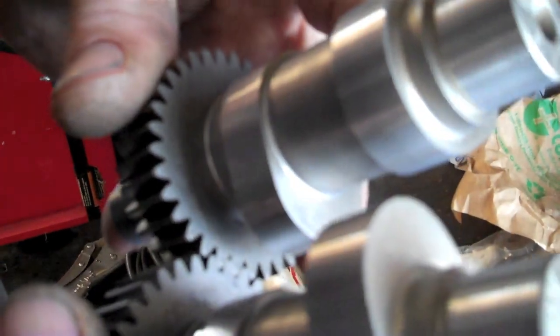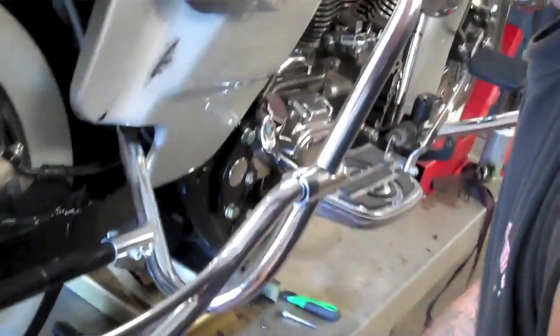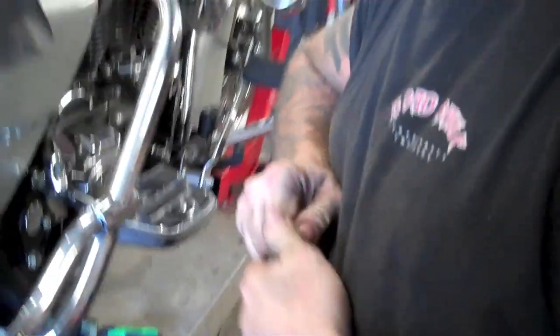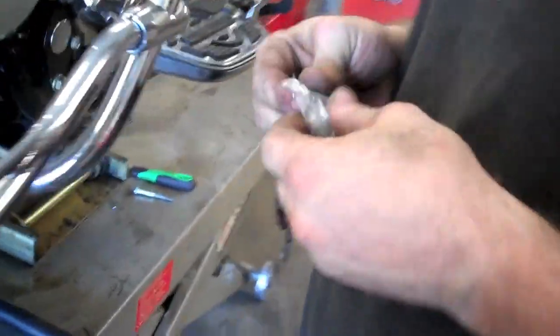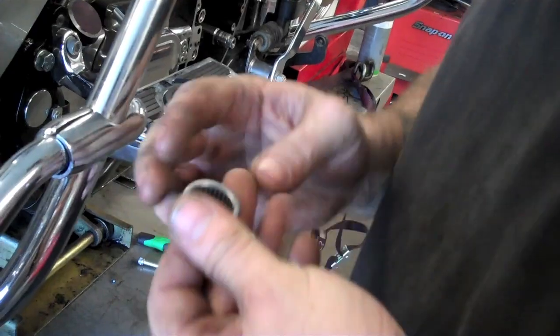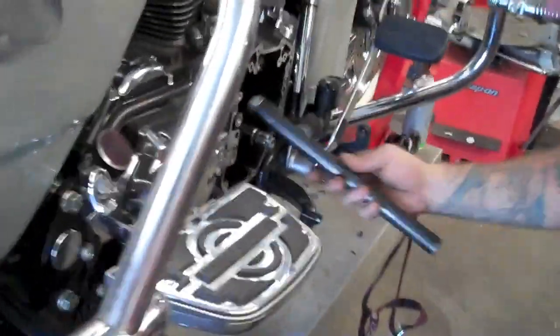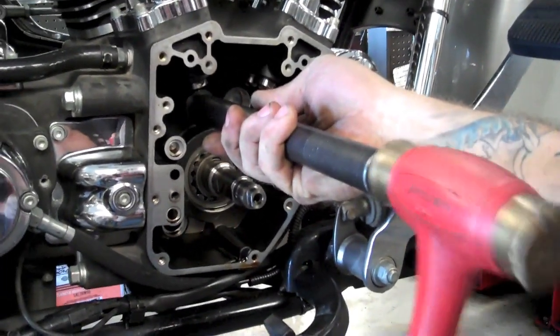These things will have little marks on them — there's one there and then the next one is right there. When these go in together they're going to go like that and then they'll go down into the cam. We got to put some bearings in. My bearings are out of the freezer, they're nice and small now. Anytime you put a bearing in, you want to put it so that you can see the words on the outside of the installation — you don't want those words on the bearings to be inside. That kind of dictates which direction they'll go. When you hear that noise, you're done.